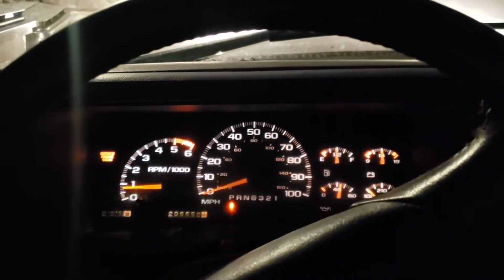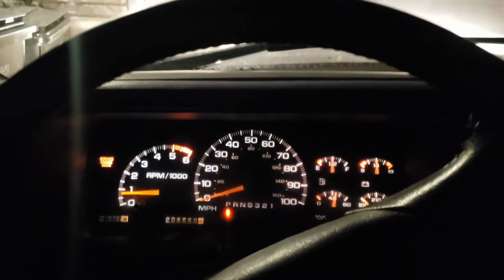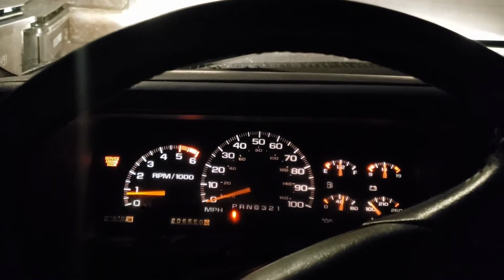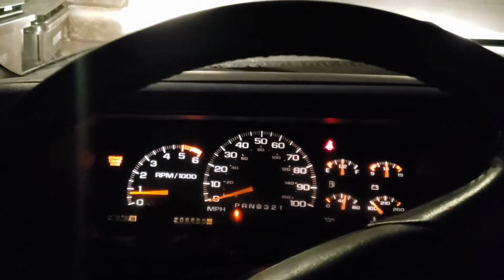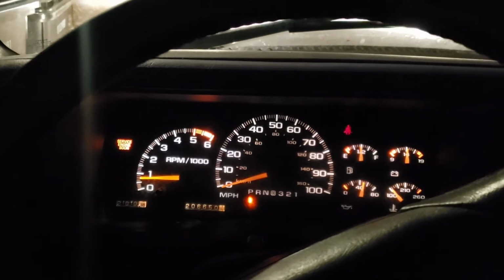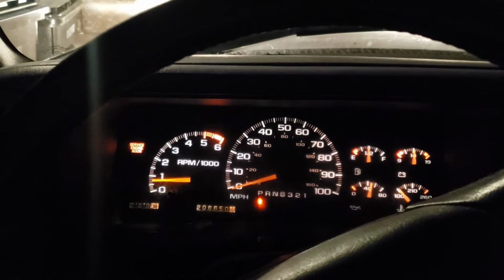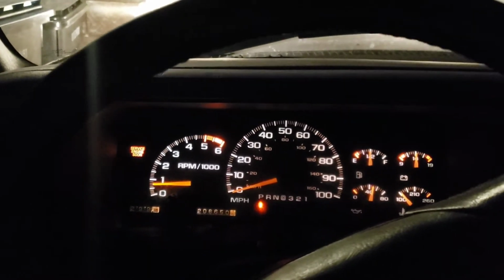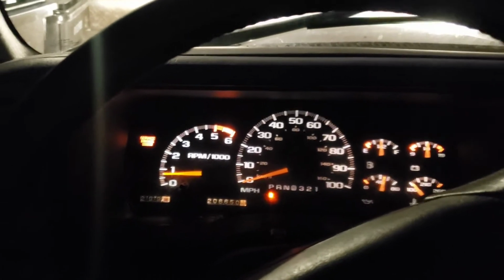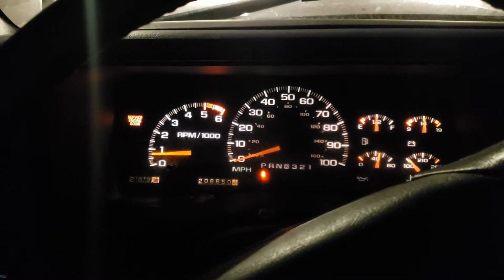Okay, it's dark. But let's figure it out. After fiddling around and checking the YouTubes for all the stuff that I needed to do for the transmission, I changed all of the solenoids. I did everything except the accumulator. Changed the wiring, changed every solenoid, changed the lockup torque, which came with the wiring kit, and hopefully I'll share the videos that help me do that. A couple little tricks. So it wasn't working. It was in limp mode before.